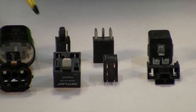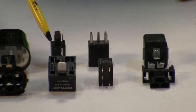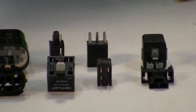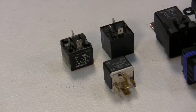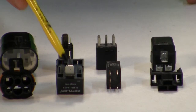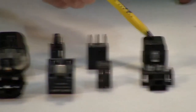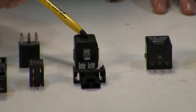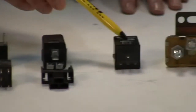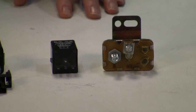This is a micro relay. This is still an ISO relay, but this happens to be a 70-amp version. You can tell the difference because of the size of the blades — on the standard relay the blades are all the same size, but on this one the input and output connection blades are quite a bit heavier. There's also a standard 3-prong horn relay that has an internal connection eliminating one of the prongs. These are different variants that essentially do the same thing.